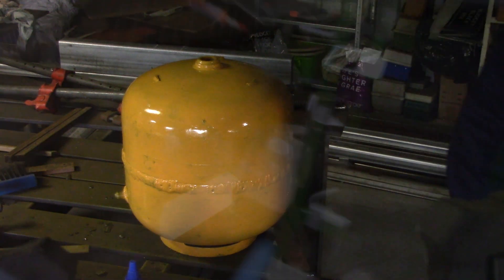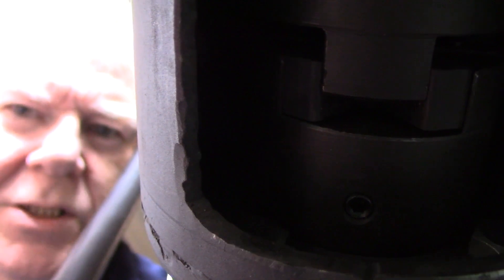This is the housing around the coupling from the motor to the pump, and that's it in there. I'm just going to try and show you what needs to be done — it needs to be pushed up together. I'm going to need both hands to do it so I won't be able to video what's happening. That Allen key there just needs to be tightened up, and there's another one that needs to be rotated around a little bit to reach — that needs to be tightened up as well. Push them together so they make reasonable contact, then tighten up the Allen keys.